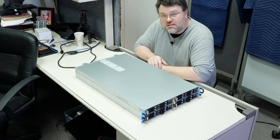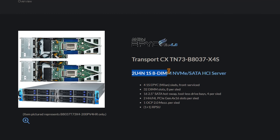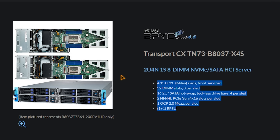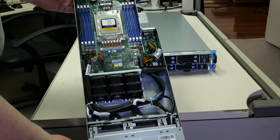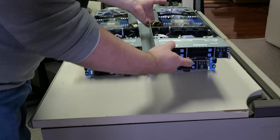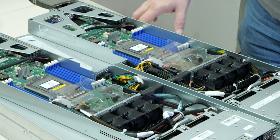And that's what makes this server so appealing. It's four separate servers in one chassis. They each have their own management interface, their own LAN, and you can do maintenance on them completely independently — so it's pretty awesome. The genius of Tyan's design is that the left and right halves share a common motherboard. It's just the physical placement of the power distribution board that varies: in the left-handed variety it's a very short cable, but in the right-handed variety it's a much longer cord that loops around to the other side. It's pretty clever and a pretty efficient use of space.